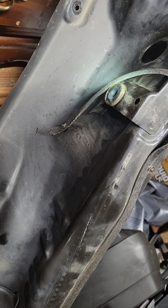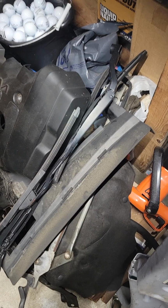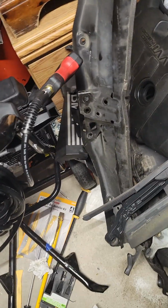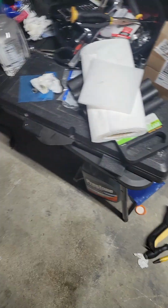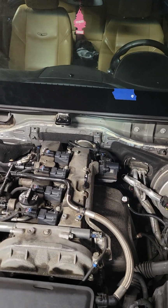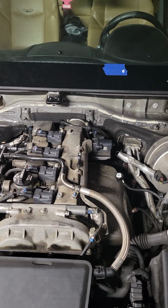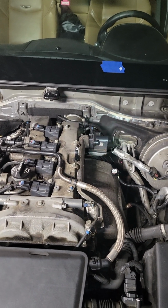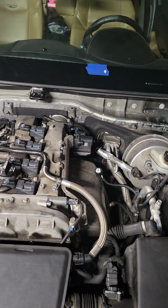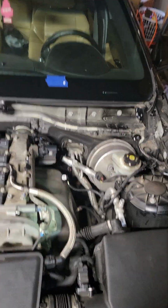And that little spot right there is where, where's my windshield wiper? You've got to take your windshield wiper blades off, you've got to take your engine cover off, and you take your windshield wiper actuator motor, whatever it is, that comes off, but that also comes off pretty easy. It just sits into that little grommet that I was showing you. I'm going to post a link. The guy shows you how to get this cowling off. It takes about 40 minutes. It's tedious. It is not difficult.